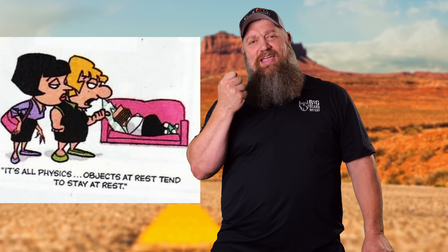They haven't been taught how this stuff works in the RV space. Objects at rest tend to stay at rest. Your compressor, not being a variable drive at all, goes from zero to a hundred instantly. It needs what's called a capacitor to build up both the voltage and the amperage for a split second — we call it in-rush. It creates a magnetic field around the compressor so it can freely get to its nominal speed as quickly as possible.